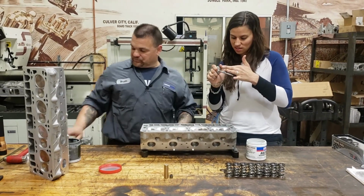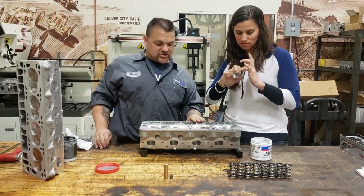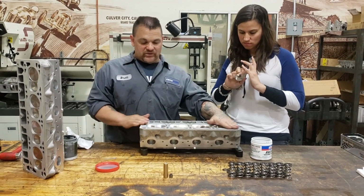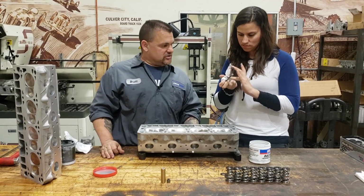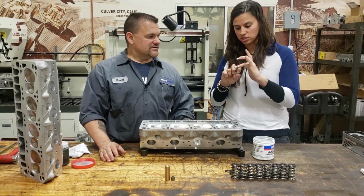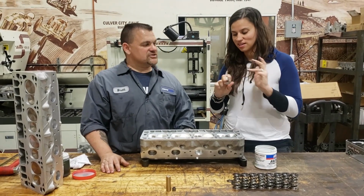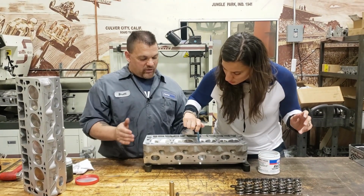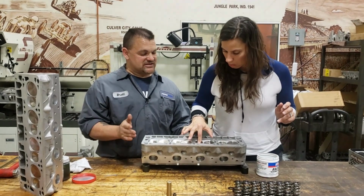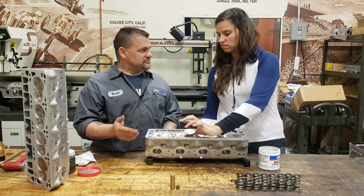As Michele's lubing that up, the head's been cleaned earlier today. We have all new stainless steel valves in it, and our CNC ported head. We cleaned it, we surfaced it, everything's beautiful. I've only ever done this once, on my Legend car, but I just put this stuff on and did the valves. You lapped it, yes. My dad showed me how. Years ago, we would lap every valve to make sure, but as machines and machining processes got better and more accurate, there's really no reason to do all of them. Oh, really? Yeah.